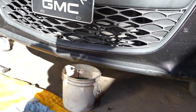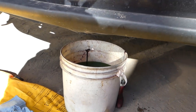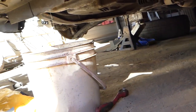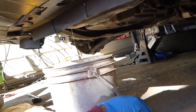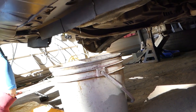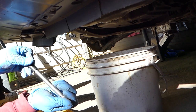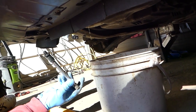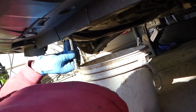The coolant is still draining — we're getting probably about six and a half to seven liters out of it. You can see it's greenish in color. Once it pretty much stops to just a few drops, put the plug back and pull the bucket out. Be very careful how you get that screw tight because this is a plastic screw — do not over-tighten it.